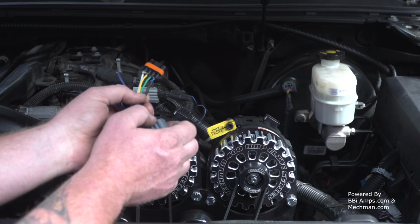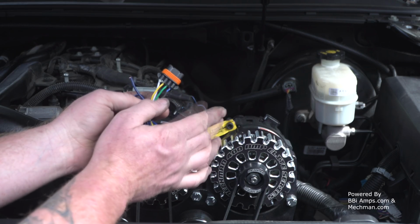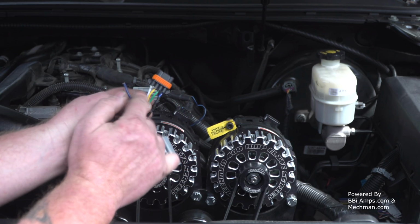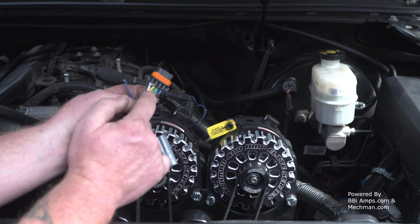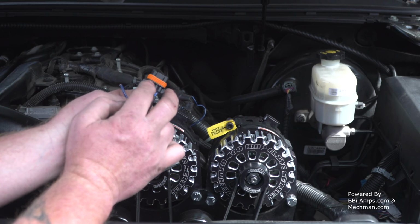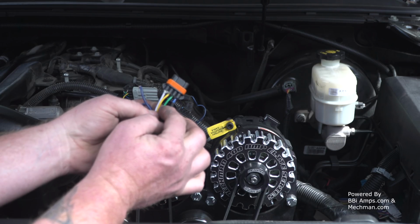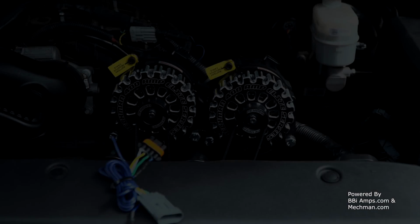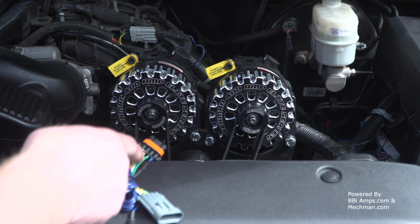In certain models the yellow wire is going to be your trigger, so we're going to ignore that. Now we're down to 2 leads, so we only have 2 options: white to white, or brown to white, and green to brown, and green to white. So what the computer actually wants to see is on the green wire. Hold on a second, let me look at my notes. I want to make sure I get this perfect for you guys. So I attached the brown to the white lead, and all of a sudden I got a 2.9 volt signal that came out of the green lead.